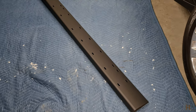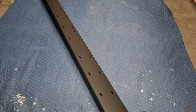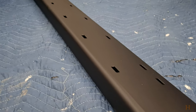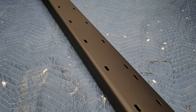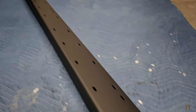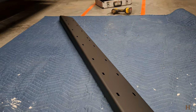It is now a couple days later. You can see I have completely finished painting my sidestep, so it now matches the other one. As I said, prep is the most important part — then follow the instructions on whatever product you use and you can get a great looking finish just like this, and save yourself a couple hundred dollars in the process. Now all I've got to do is put all the plastic parts back on and put it back on my truck. I'd never use this type of bed liner on an actual truck bed because you'd need a ton of it to get it nice and thick, but for something like this I find it perfect.